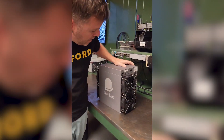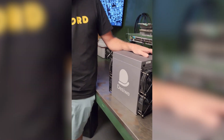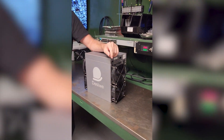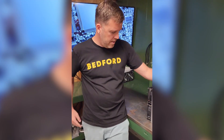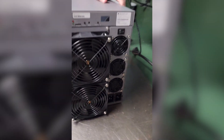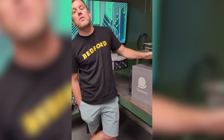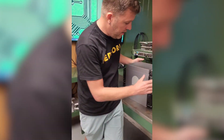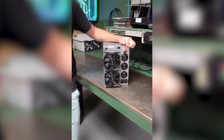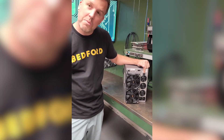It's got this little screen on the front and it was telling us it was running at 22 joules per terahash — pretty fantastic. It's a little smaller than the S19 XP but heavier because the heat sinks are more heavy-duty with the pipes and all the chips — there's so many chips it's a density thing. We don't normally see a thousand ASICs in a miner this size — the XP has about a third that in chips. This thing is set up to run at pretty high power with two C19 plugs and a power switch — it's not C13, it's C19.